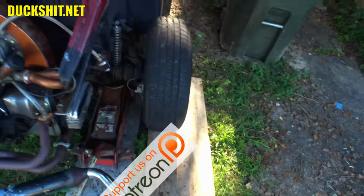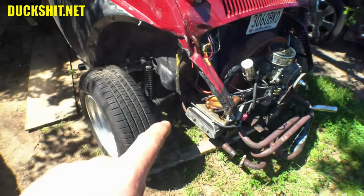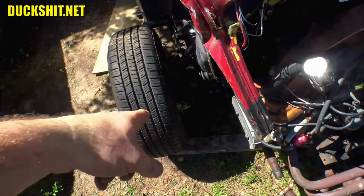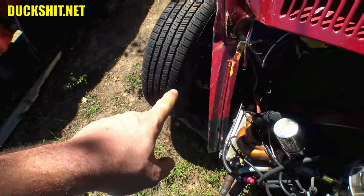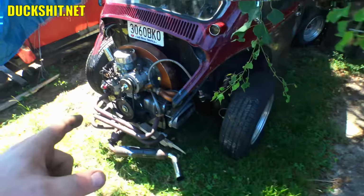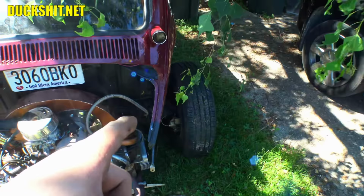All right, good. Okay, where we left off is we got the whole rear end reassembled, new CV joint, new trailing arm, new spring plate, changed out the brake line because I re-clocked the brake caliper to the rear rather than on the top, so that way the bleeder screw actually lets air out of it. Did the same thing on this side, re-clocked it and put a new brake line. Discovered both the axle nuts on this side and that side were both loose, so this car was going to eventually lose a wheel. But again, in hindsight, those calipers may have actually retained it, but it doesn't mean the car wouldn't have been wobbly or done all kinds of weird rubbing noises, which is something Rob said he was experiencing.